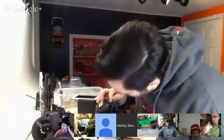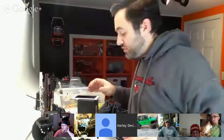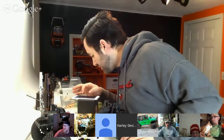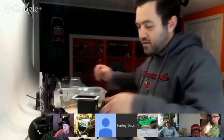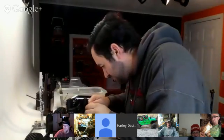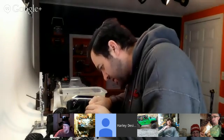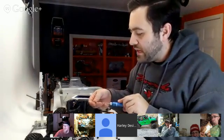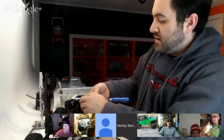Looks like I need a new spur gear. This one is too big. Or I can modify the chassis, it looks like. I go for option B. Modify. Get out the Dremel. Yep. It doesn't require much. It looks like on their website they state that if you use the Twin Hammer's 78 tooth spur gear, it doesn't require modification. But this way, if I ever do chuck a spur gear, I won't have to worry about which one I'm running.